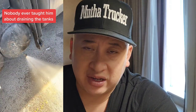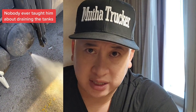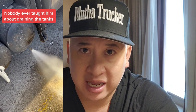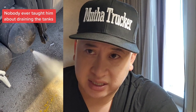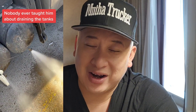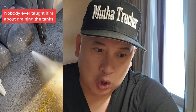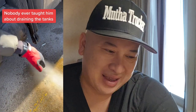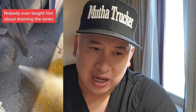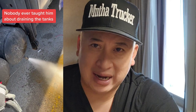And so basically what happened was, I don't know if he was at a truck stop or not, but he makes this video that says nobody ever taught him about draining the tanks. Your tanks are extremely important. When we talk about your brakes, when water gets in there and it's cold enough outside, your airlines can freeze up and then you have no brakes.